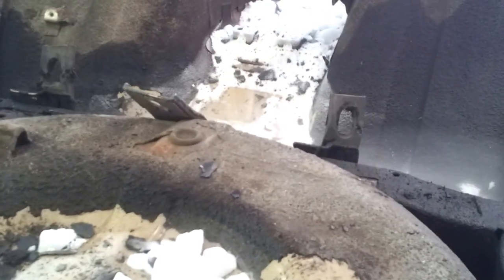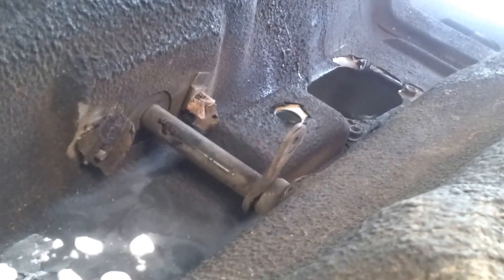So the method I'm using here is actually dry ice. Dry ice can get a little bit expensive if you're buying a lot of it, but you only need a little bit. This is 10 pounds, which is about 12 bucks. It works pretty good. Basically what you're doing is just making the undercoating brittle and you can just hammer it off.